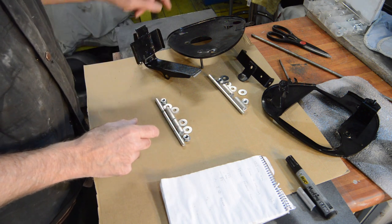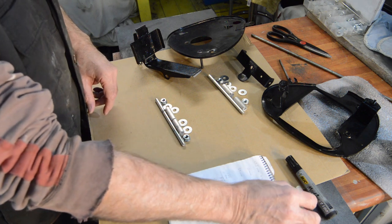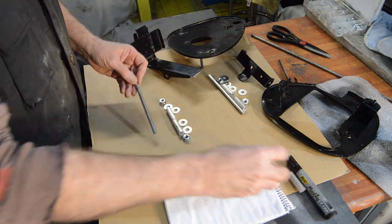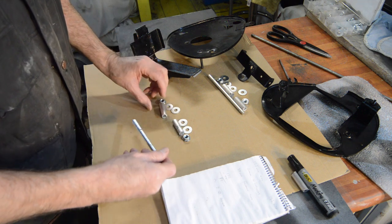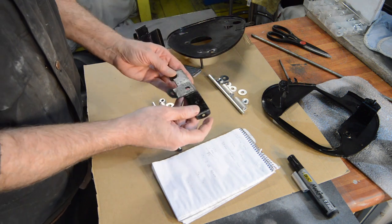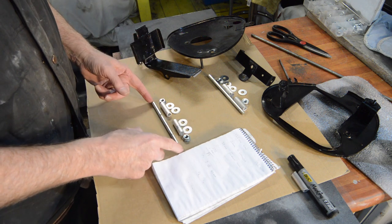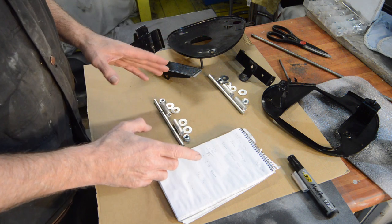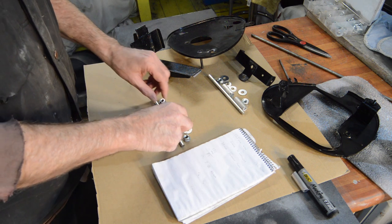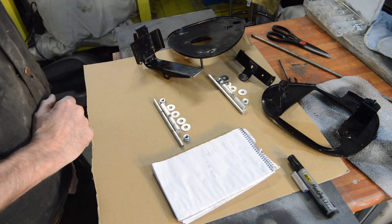The two that you saw last time are for the air filter, to space the air filter out. So I had to make them up. And luckily I found a bit of aluminium tube, which wasn't quite the right bore size, but I managed to drill them out successfully. And by doing some quick calculations, the only thing I could go off was to assume that the whole system was parallel to that. And the fact that the replacement bolt on one of the websites said it was 6 inches long, which is that, which all appears to be all right. So a quick calculation in millimetres, because that's a British bike, I find it easier to work in millimetres, left me with that as the appropriate size for the spacers. So we'll go across the bike and see if it works.